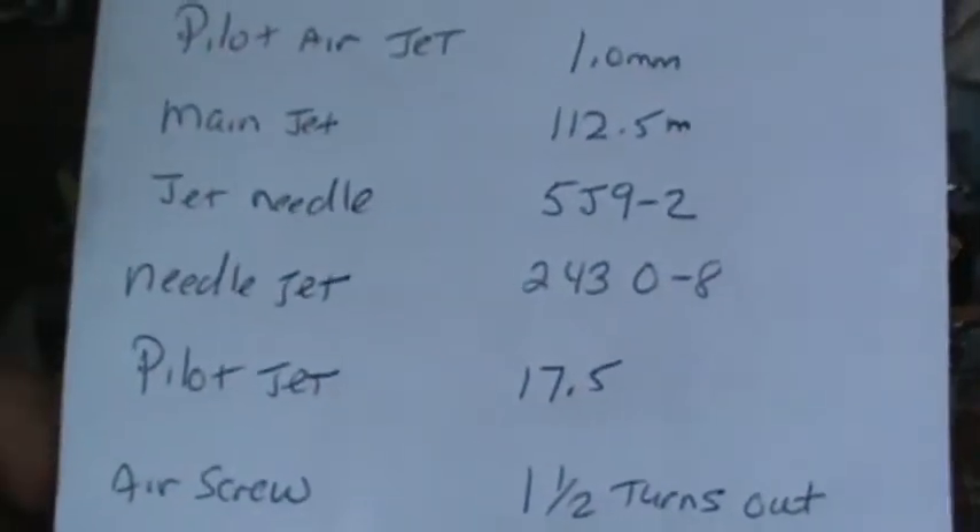You can get the jet numbers here just to make sure that you've got the right needle jets and the right pilot jets — there are numbers on them. Check all those, make sure that somebody hasn't changed them from stock. I know they haven't been because I worked on these last, so they're correct. But it's always something to keep in mind, because you never know who worked on the machine and what pilot jets or main jets are in it.